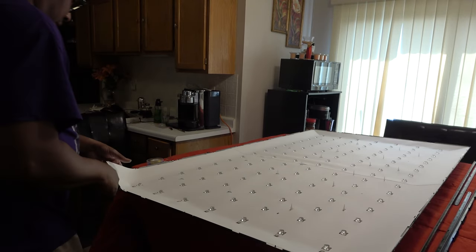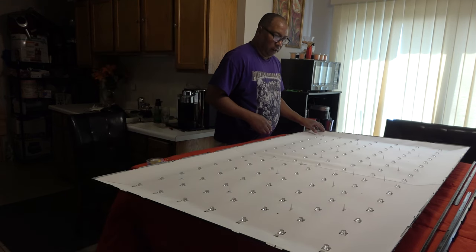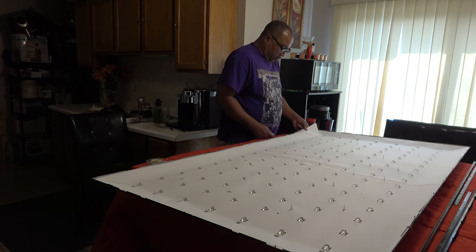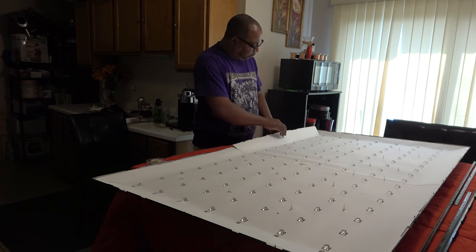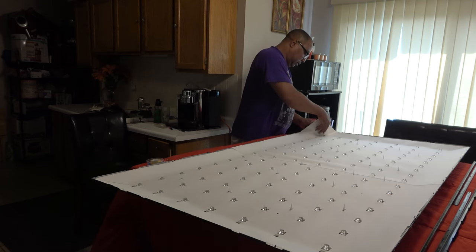Okay, now we are at our LED strips. Now we know that the one on this side was bad. And these are the 8-strip LED strips. The other ones use the 6. I'm sorry, this is the 8-light LED strip. The other models use the 6 on each one. Obviously, this TV is a little brighter in comparison.